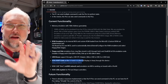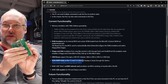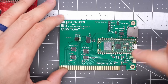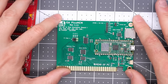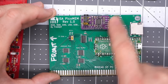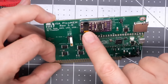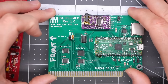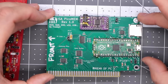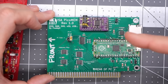Freddy also recently added postcode support — a little alphanumeric display that shows diagnostic codes as a system boots to help you troubleshoot your machine. And there's one more thing Freddy added that's not on the GitHub repo that I have tested — it's in very early alpha. You look right here and wonder what this is? It's a DAC, or digital-to-analog converter, with a 3.5mm output. With the custom pre-release firmware, this adds AdLib support to the card as well. While it's booting your system and emulating disk drives, RAM, and everything else, you also have an AdLib card — all on this one thing.